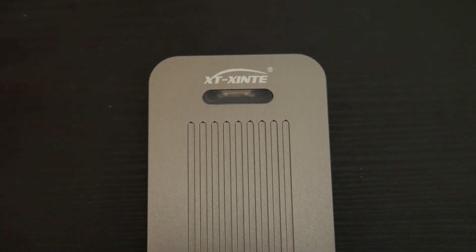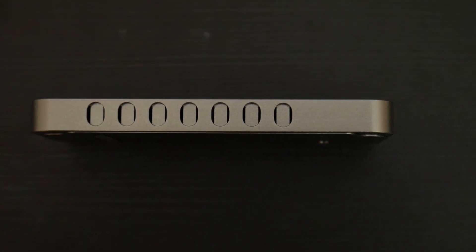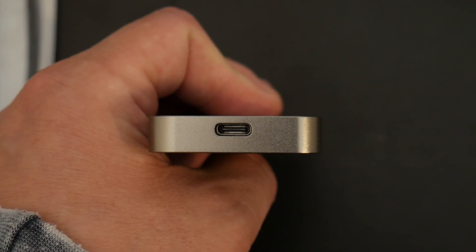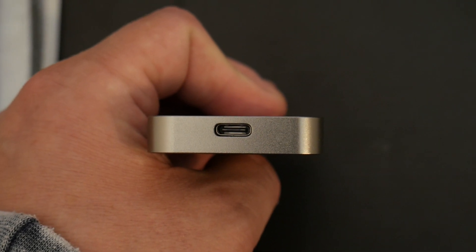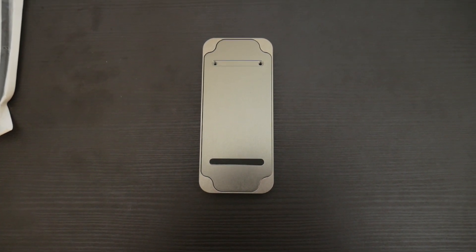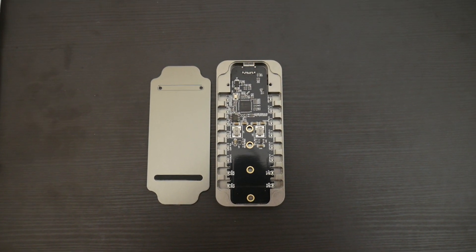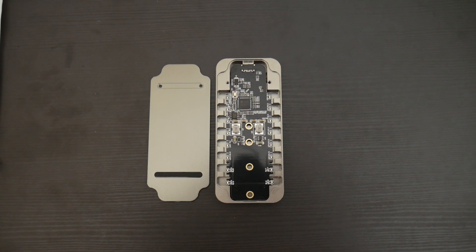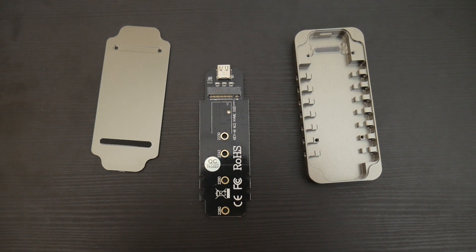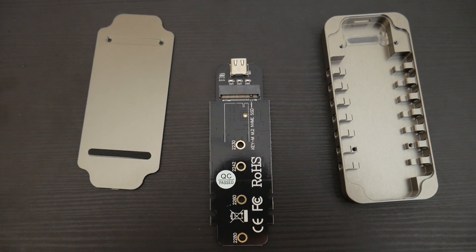Here's one more look at the enclosure — it's the XTXINTE. There are some lights on it, and the sides have ventilation holes all in aluminum for heat dissipation. The front has the USB Type-C connection, and at the very bottom there are two screws to open up the unit. Once open, you'll notice you can't put the drive in directly — you have to take the internal board out first. There are screws on the little black board you need to remove, and on the other side is where you insert the SSD. You insert it there, screw everything back in, then connect to the computer. No power adapter needed.